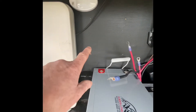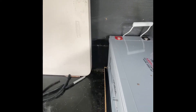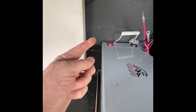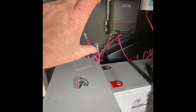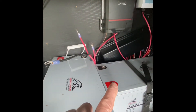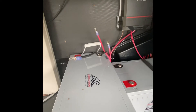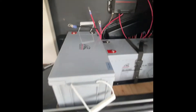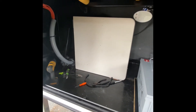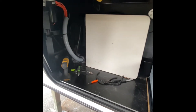I'm going to put my Victron smart shunt probably here, because I'm going to put a couple of grommets in here for the power coming from the back of the truck. That will be power and ground going onto the negative on the Victron smart shunt. Then I'm going to have my big 400-amp T-fuse mounted right there, and then power to power, negative to negative. I still need a bit of room to get the table in there - unfortunately I can't get my big table in, but I think I need power more than I need the big table in this bay.